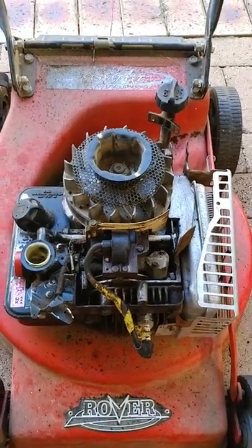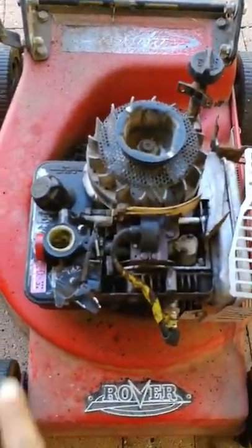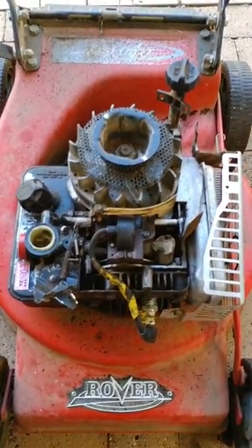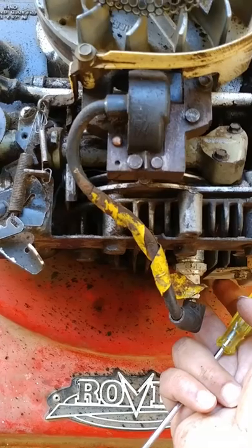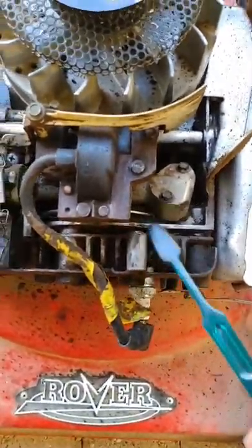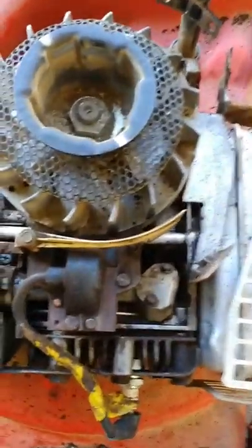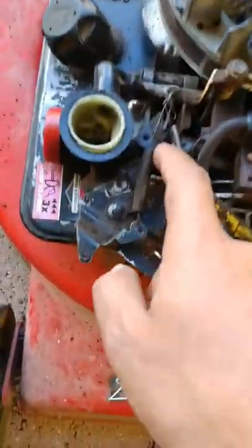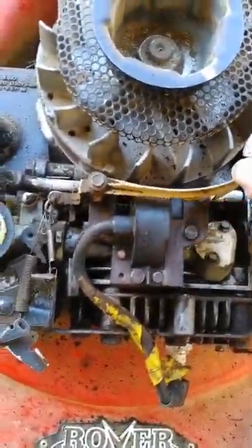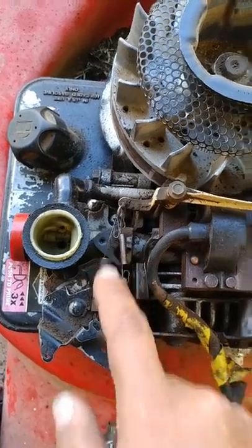I've taken the cover off the lawnmower, and the cover is sitting there with the cable still attached. I've also taken the air filter off. It doesn't hurt to get a screwdriver and just clean out these fins, because you get grass in here and it blocks the cooling of the engine head. Also get an old toothbrush and just clean off the dirt over the engine. This is the intake pipe which goes to the carburetor - the air goes through here through this butterfly. This is the governor, with two governor springs. These can be purchased online for eight dollars if they are broken. And this is the intake, and you've got the exhaust over here.